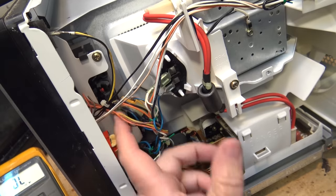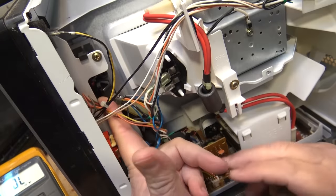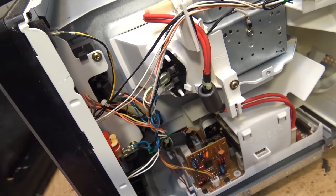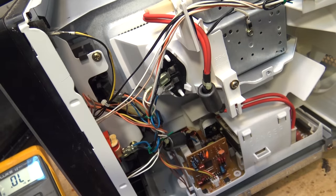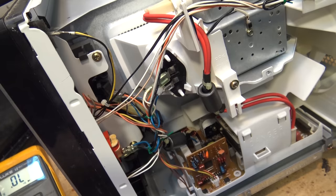When these units work they're really a good microwave. The one I found in the same recycle bin at work - I'm hanging onto it because it's a bigger unit and it works great. I think the person scrapped it because it became a volcano - they boiled water and neglected to realize you can't do that in these 1200 watt units. On this unit the waveguide is midway up the top, so microwaves go in about the middle of the cavity. The larger ones have the waveguide at the bottom, which heats food very well.